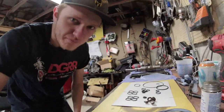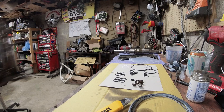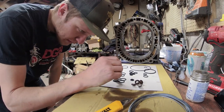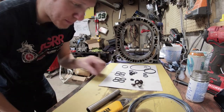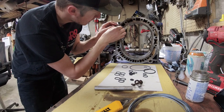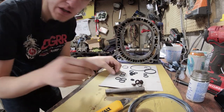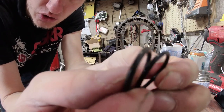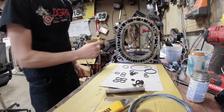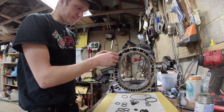Next, figure out which O-ring is your dowel pin O-ring. Lay out your housing, grab a dowel pin — there are two sets of four and you want the proper ones. They should fit nice and snug. You'll notice there's a thicker, more beady one and a thinner one of largely the same diameter — it's the thinner one of those two. Put some High Tack in the hole to hold it in.